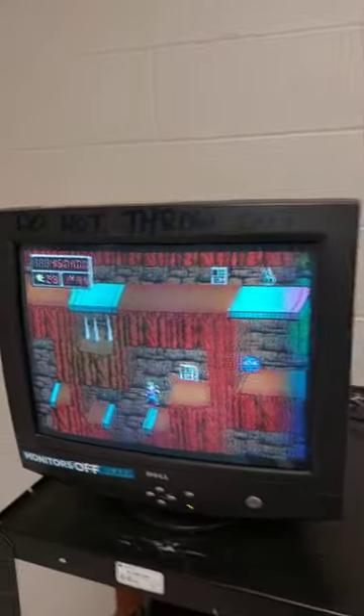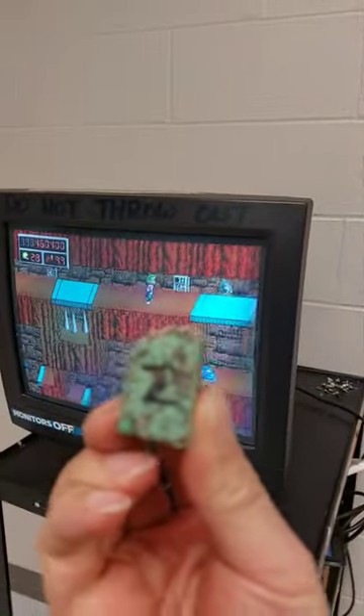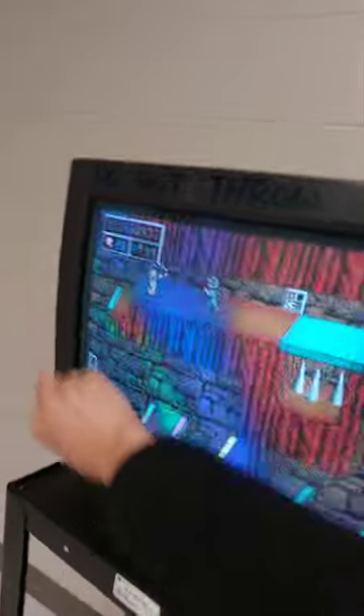The reason why that happens is because this monitor is big due to the fact that it has an electron gun right here. It shoots electrons right to the front of the screen. One of the unique properties of electrons is that they can be deflected by a magnet. So if I bring a magnet nearby, it does some wonky stuff to the image, like that.